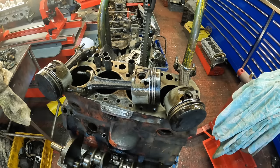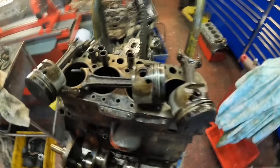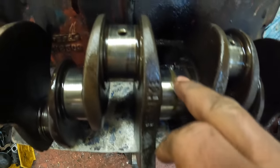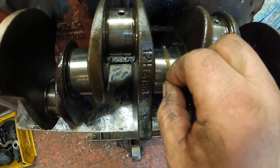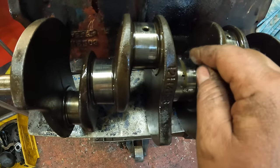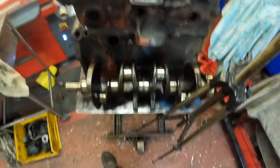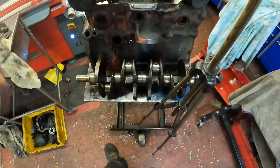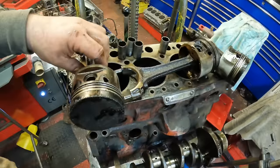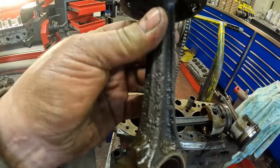The crankshaft is in relatively good condition, but if I just unclip the GoPro and show here, this is in the oil ways. This has come off the crankshaft. I haven't touched this. This is more boring bar swarf. And I'm putting it back on there because when I strip an engine nowadays, I do a full report and I take some photos with my GoPro and send it, and I really feel that my customer really needs to see this engine. The conrods, where that swarf has been flicked around, it's destroyed the conrods.